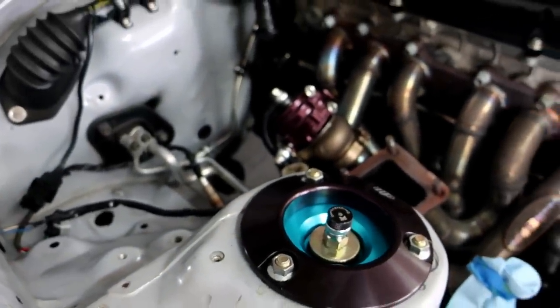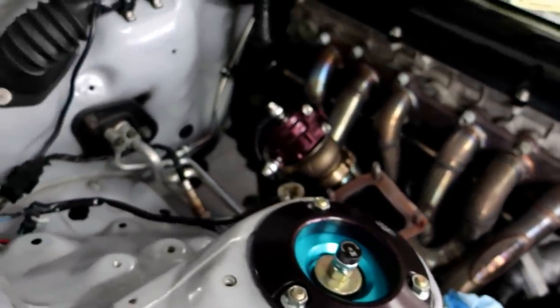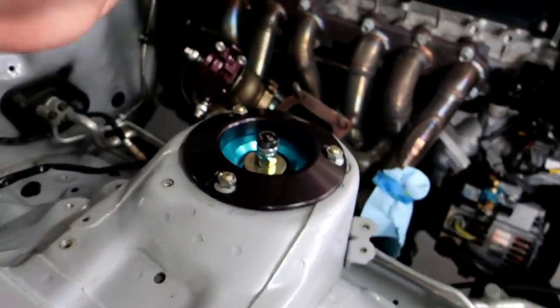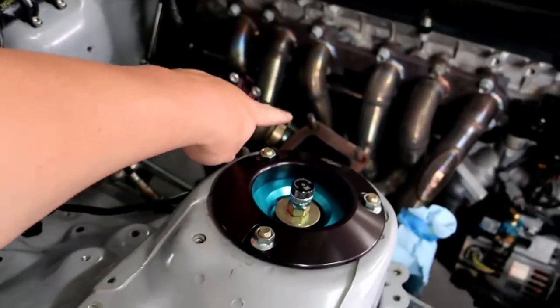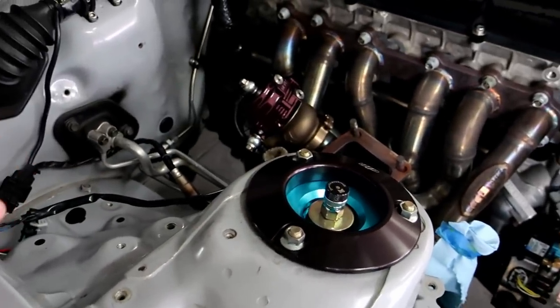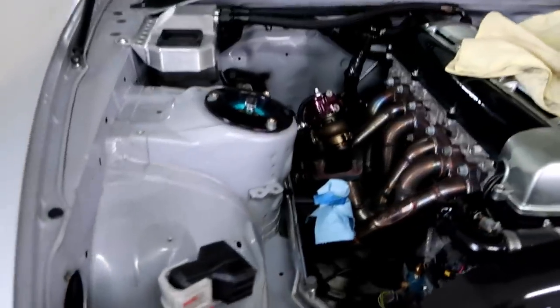I think that's what makes it so nice and has worked out so well for me so far. I need to take the wastegate off, but that bolt down there stripped too. After dealing with that, I'm just kind of holding off on that right now, but I'm going to go ahead and take this stud out. I forget if it's reverse thread or not, but I guess I'll find out here in a minute — going to have to put some vice grips on and hope they come off.